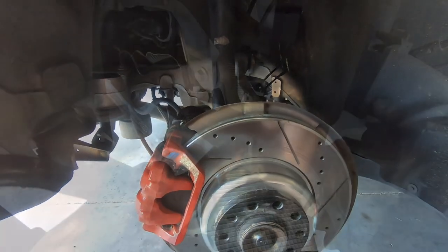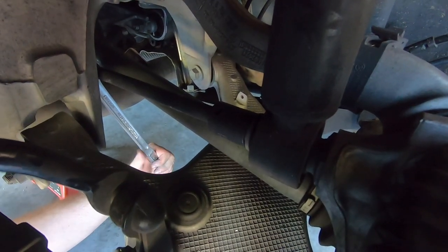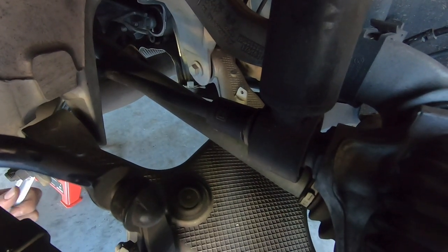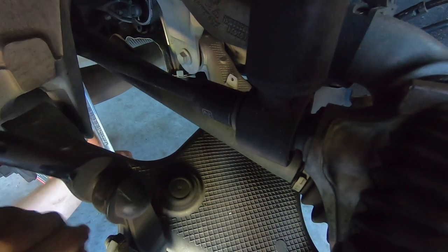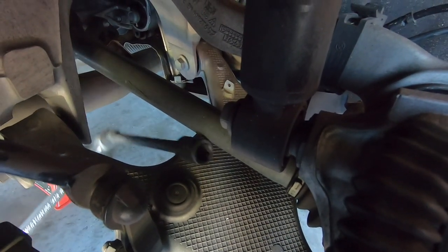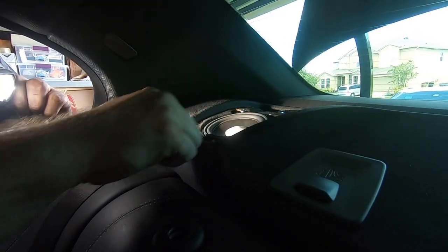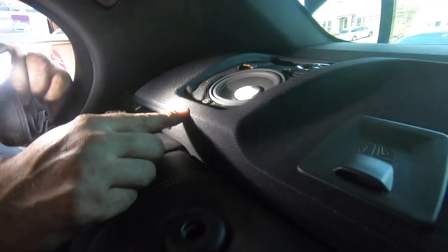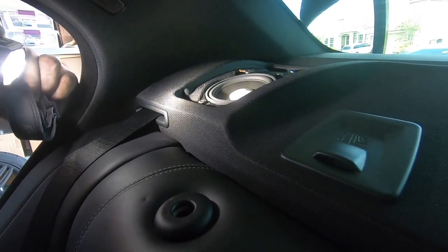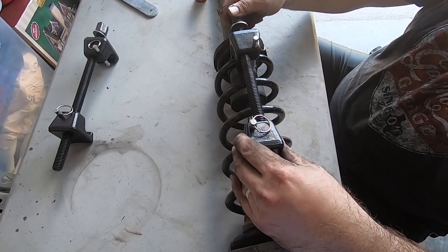You can see I've got the 21mm, an extension and a breaker bar. With enough power you'll break that loose — that's really the tough part. Once broken loose, go ahead and take that bolt out and drop it. To get to the top of the shock, there's a little speaker grille — use a pry tool to pull it out of the way. There's a little speaker with three screws; pop that out without disconnecting it, lift the foam pad, and there are the three bolts right there.